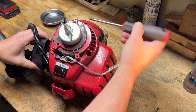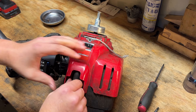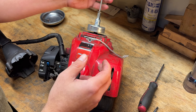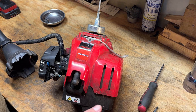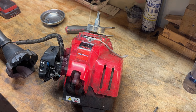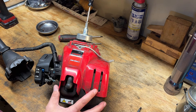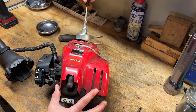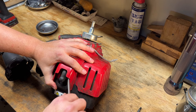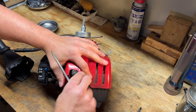And then there's another three — one here, here, and here. But before we do that, we've got to get this clutch off. This is a T-20 that fits in there for the clutch. But if you try to unscrew that, the whole engine turns. So you need to stop the piston from moving up and down, and usually you can do that with a piston stop tool. I'll bring that out once I get the spark plug out.